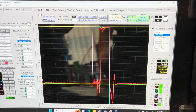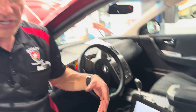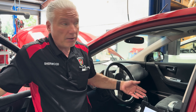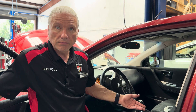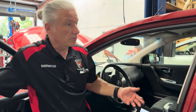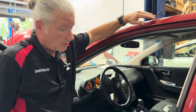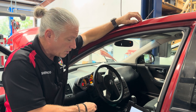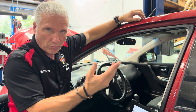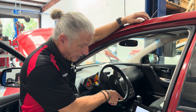This is a fantastic example of an intermittent problem with a latch that's not functioning and we can't duplicate the problem — this is a perfect example. When I sit there and hit that thing, you guys saw it mess up a bunch of times. This makes sense why the latch was replaced a few months ago and then it started messing up again. Evidently the latch was replaced in this thing a few months ago, and maybe it hasn't gotten hot yet. We're in the middle of summer now — it's getting really hot. I guarantee the inside of this car is getting hot, causing that relay to get hot, causing this issue. I'm recreating the heat by activating and activating — nobody's going to sit back there and pull on that, but we were able to recreate the problem and look for a voltage drop.